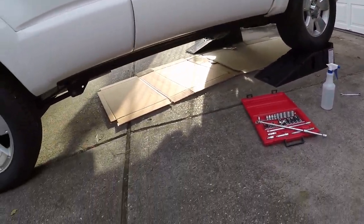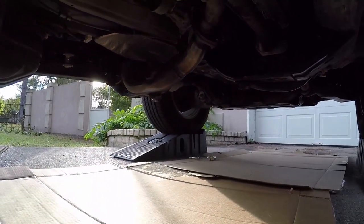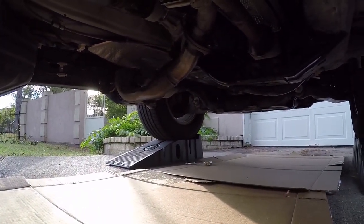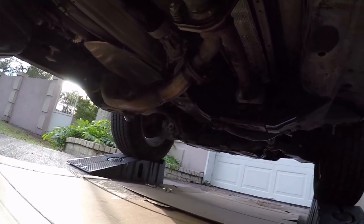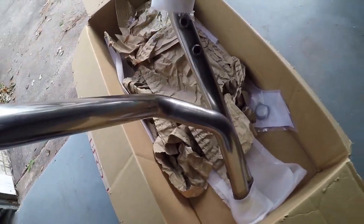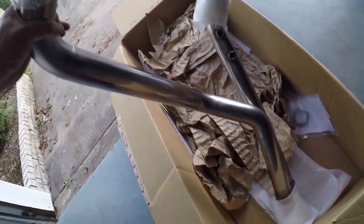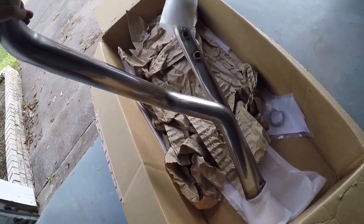They are helping me a bunch. Today I'm going to be changing out the mid-pipe section that has two catalytic converters and I'm going to be installing a Y-pipe. This is the Y-pipe I got and there are a couple gaskets with it. It's made by URD, also known as Underdog Racing Development.